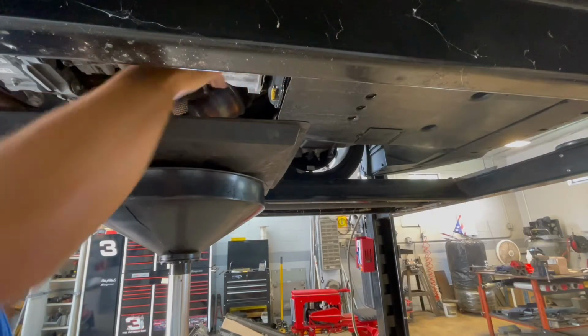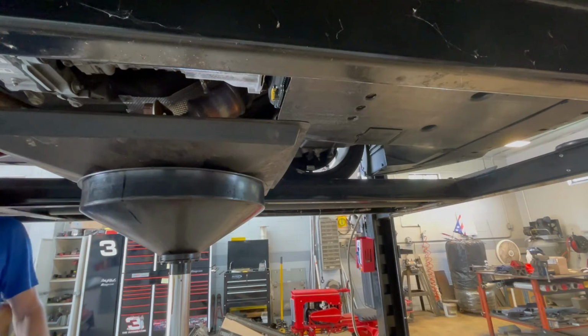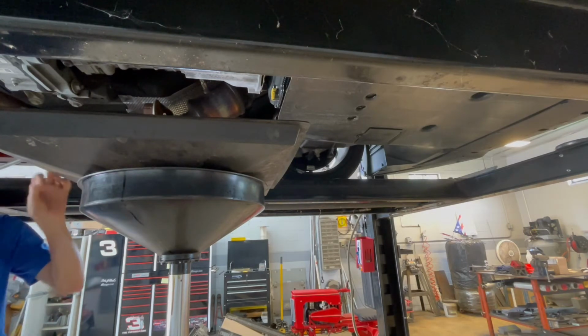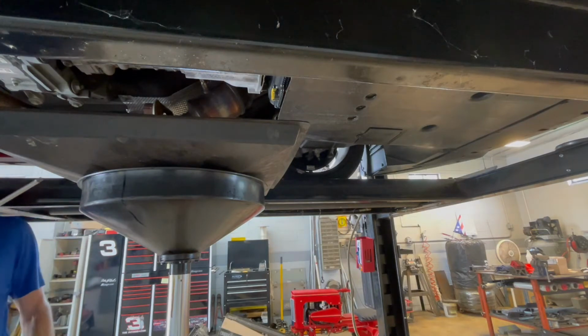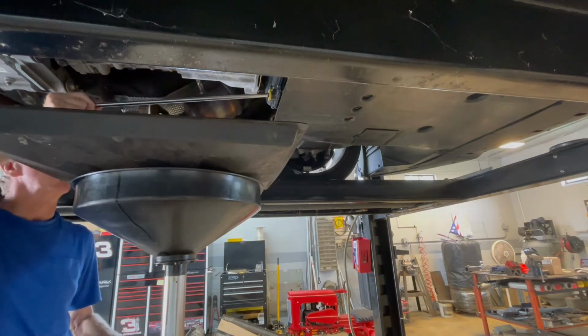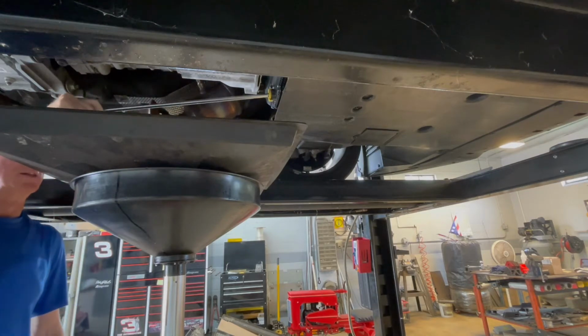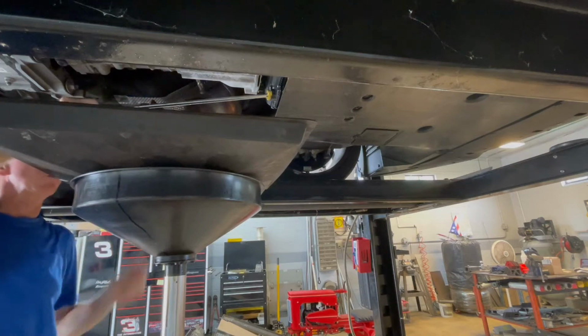Now what I do is when I break that free, then I just pull it out with this. I hold it. I control the flow of oil with this, by not letting that plug come all the way out. And it works good because then you're all the way back here. And then once it gets down a point, you can pick it out all the way. That's how I do it. You gotta get past the tab lock on that first. You push in a little bit, and then that turns and it's free. And it'll start coming out, twist itself right out.